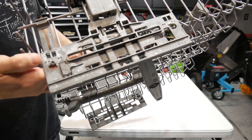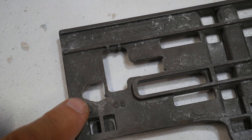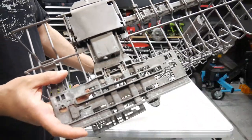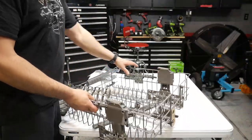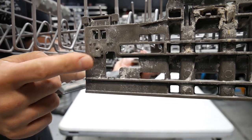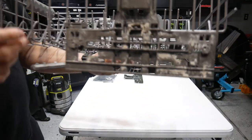Take a close look — you can see it's cracked up there, and then this side has snapped off. It actually fell out of the metal rails that slide this in and out of your dishwasher. This side was hanging down. This side over here is still good. It's supposed to have this nub on the other side — that's what locks into your rail.